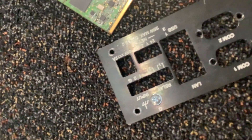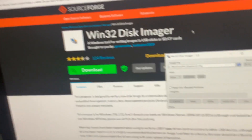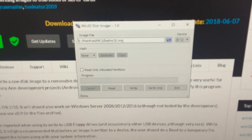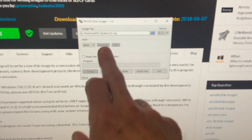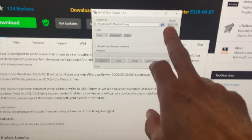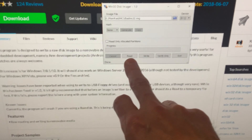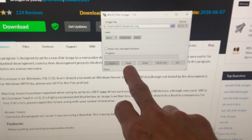Then you use this software. You put it in, name the file whatever you want to keep it, and select the drive where it's plugged into your machine — you have to use a PC. You then read the bad card. It does read. The data is still there — all your files are there, your program's there, everything's still there.